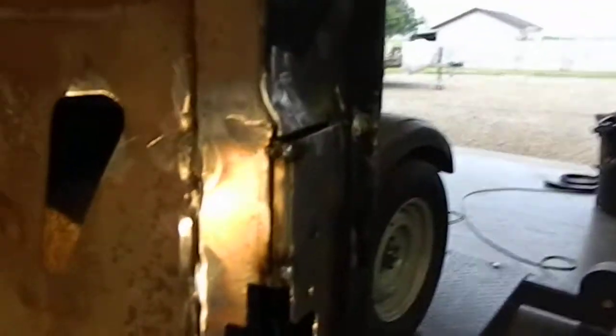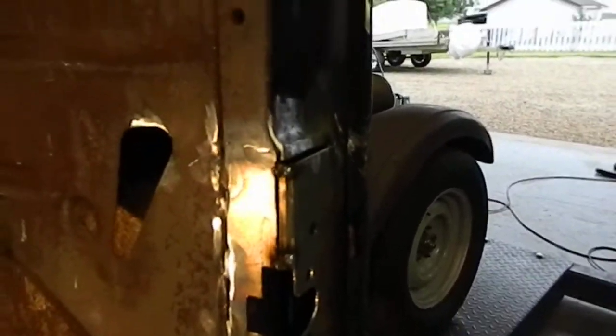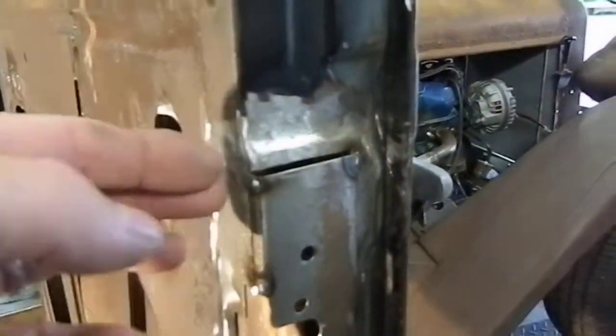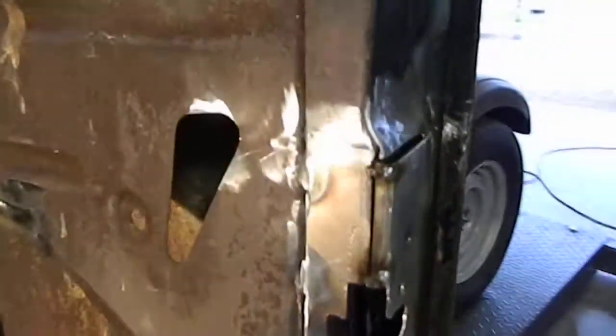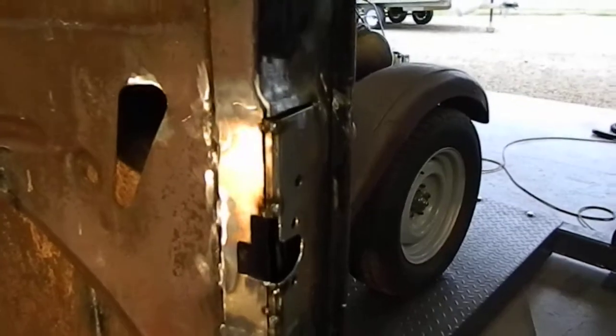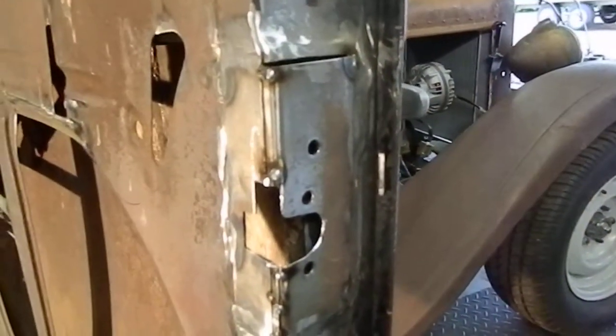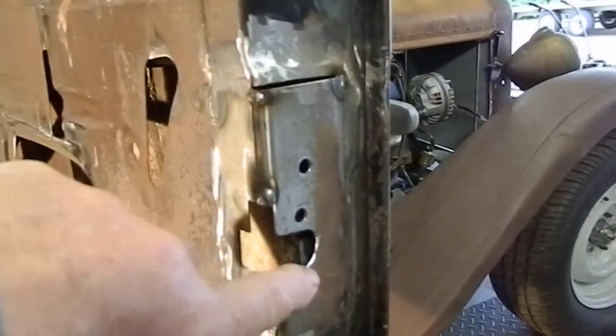Where the issues are is in here — everything's trying to take up the same spot where the track is. The bear claw mount was mounted flush here. I had to cut the mounting plate out and move it out about three-sixteenths of an inch, which has caused clearance issues on the door jamb where the big washer is that locates the striker stud.